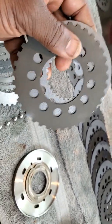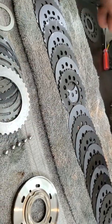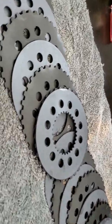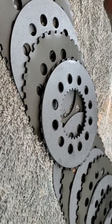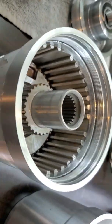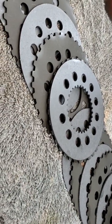Over OEM, these clutches have 65% more surface area than the original. That is good because it provides more friction surface to transfer power through the OEM coupler, allowing us to keep the OEM coupler size, shape, and dimensions on the outside, and allowing it to have unparalleled fitment to OEM differentials.